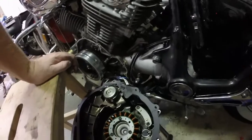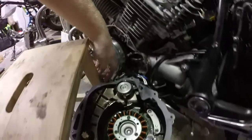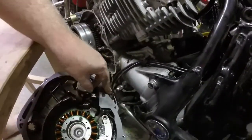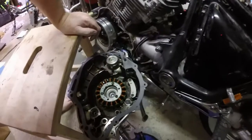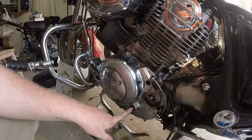Getting the gasket on is being a bit of a pain in the butt. There's a little thing here that you can use to hook it on - it fits well. It's just my new stator wires need to be bent down and stay in place while I put it on, and that's needing three hands. Using the shifter sprocket as sort of a guide.